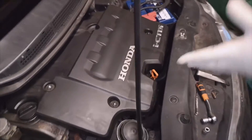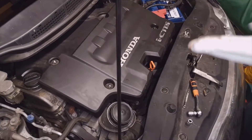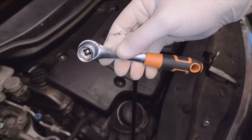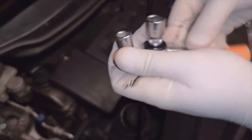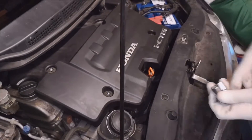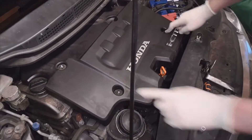This is a quick video on how to remove the EGR valve on a Honda Civic 2.2 2007. You're going to need a small ratchet, a 12mil, and a 10mil. That's really all the parts you should need. I'd also recommend having some WD-40 because some of the bolts will get tight.